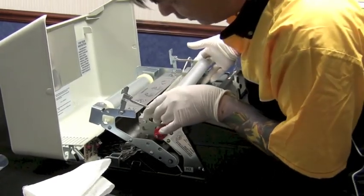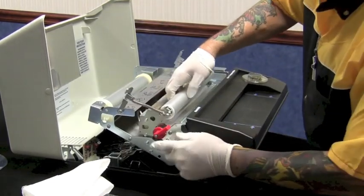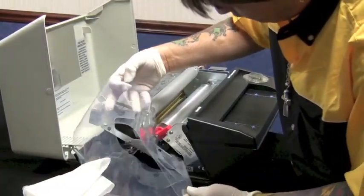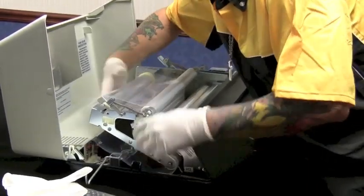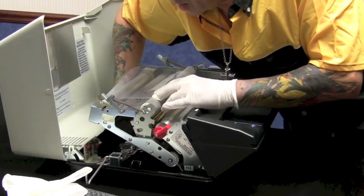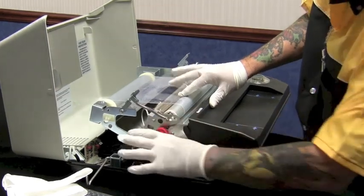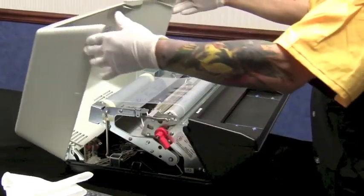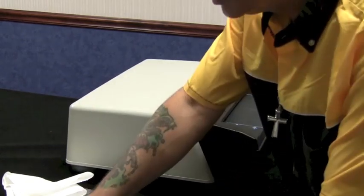For reassembly, start with the left side — you need to lock that pin back into the frame rail; the right side just lays in. Keep your assembly loose while working, then hold your belt back in. Make sure it clears your transformer underneath. Lock the whole assembly back in, then engage the red-handle spring latches. She's completely back together and should be ready to make a copy.